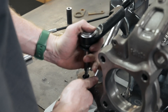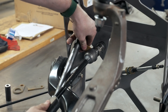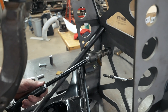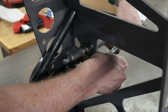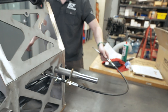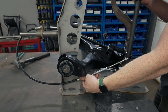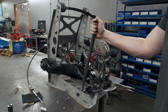After a quick polish, tack, and weld, we place this back into the jig where I need to check the length and see where I should position the steering rack so that when the wheel is straight I have an equal amount of in and out movement — see where the cable lands, just kind of feel it all out. I know there's some adjustment range so I wasn't too particular. We're going to throw a couple tacks on the ram and hook the cable up. This is a tab I made — it actually gets pinched between the steering rack and the inner tie rod. We actually ended up changing the original design at the end of this video to be a second lever that pulls the cable rather than just a knob.